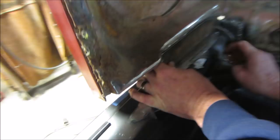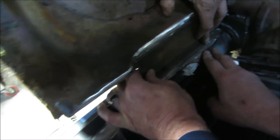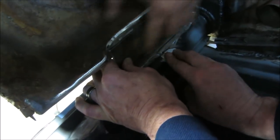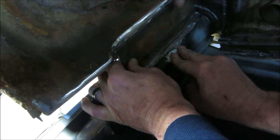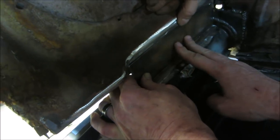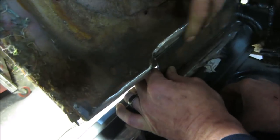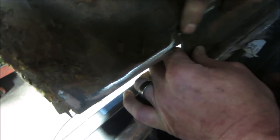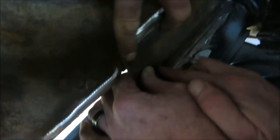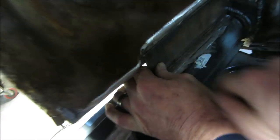What's your thoughts? I think it's pretty nice. Take a Sharpie and mark right where this weld is. See there's a gap up in here — if you grind some of this away, the piece can go in a little more and we'll be able to bridge a weld right up the side. Take the flapper wheel and come in right there — sand away until you don't see that black Sharpie anymore. Don't go overzealous — it'll go fairly quickly.